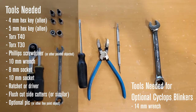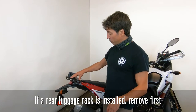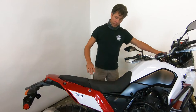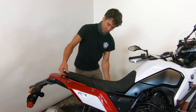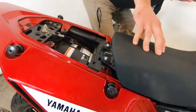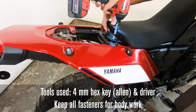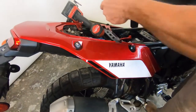To get started, many of you will already have the Alt-Rider luggage rack installed, so start by removing that — just do the reverse of your instructions. Then we'll get started taking off the bodywork. With the Alt-Rider rear rack removed, go ahead and pull the seat. Once the seat is off, you'll find the bolt system holding it down — grab your M4 driver and back off those bolts, keeping them contained for reinstallation.